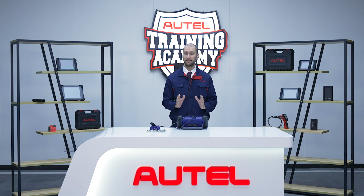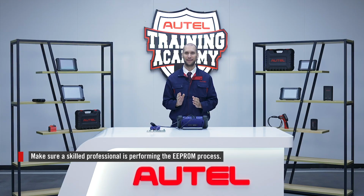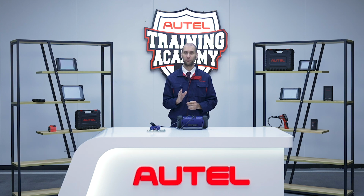Once Make Dealer Key is successful, you can then move on to Key Learning, the last step in the process. You will need to connect your JVCI into the OBD2 port for this last step and learn the key. The EEPROM key learning process is very simple. Just make sure a skilled professional is performing this process.